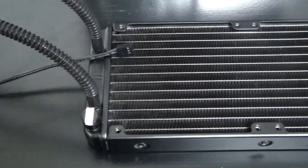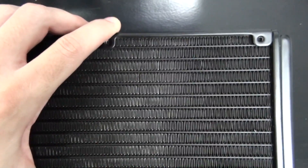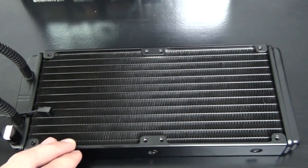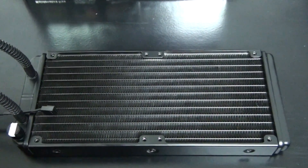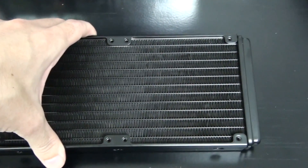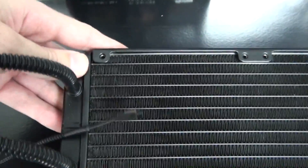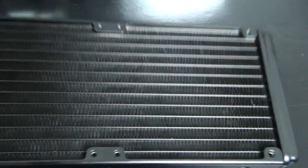It's amazing how often I see rust on the outer panels of radiators because a lot of manufacturers use steel outer panels. Now there are some problems with using an aluminum radiator — heat conductivity is not going to be as good as copper, and galvanic corrosion can be a problem if you mix metals in a loop. But I'm sure Cooler Master has dealt with this, potentially with their coolant, and they do have a two-year no-maintenance guarantee. Also, a testament to their care during manufacturing, painting, and packaging: the fins are in almost perfect condition — no damaged or bent fins, which are very easy to damage.